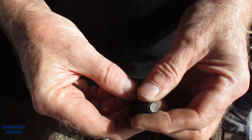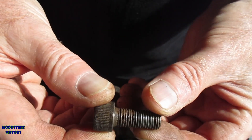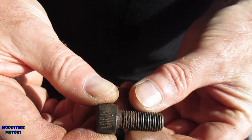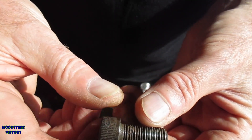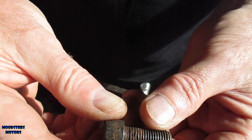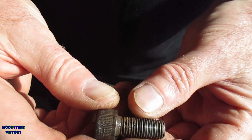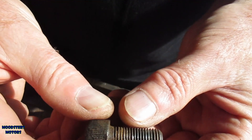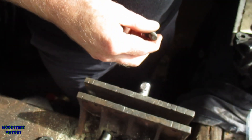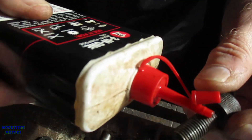One of the jobs to do is to clean up the bolts that hold the caliper together. As you can probably see, the threads are looking a little gummed up — it's either corrosion or, more likely what I suspect, a Loctite solution that's been put on to prevent the bolts from loosening and potentially the caliper coming apart. So, splash a little bit of machine oil onto the threads.